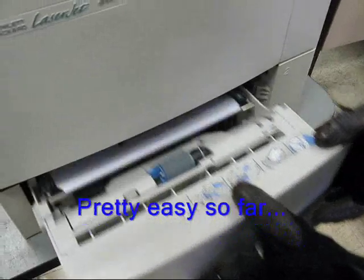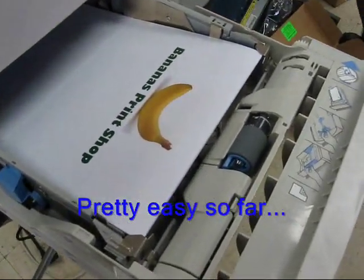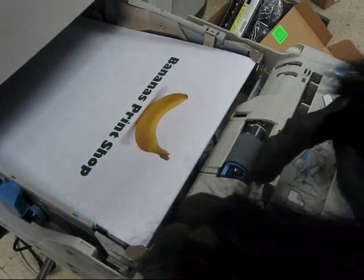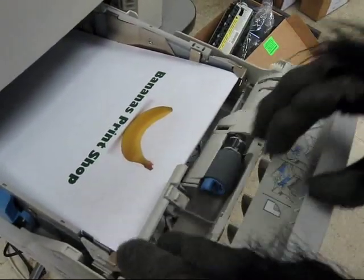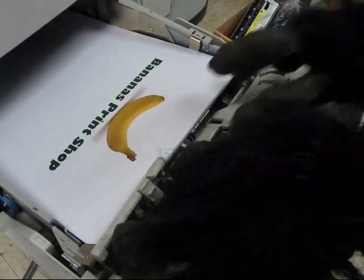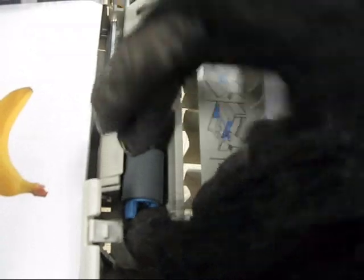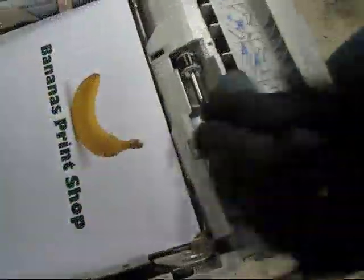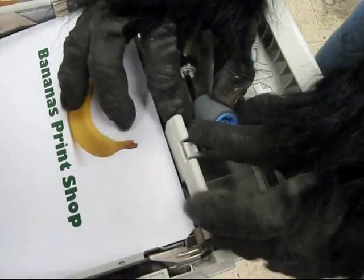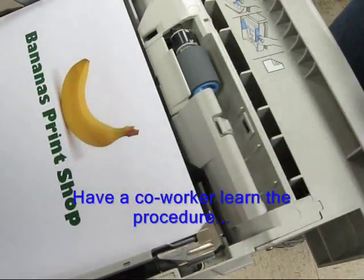Open your paper drawer. Locate the little door on the left side of the paper drawer and flip that open. Once that door is open, you can press the tab on the roller and it will slide off the shaft. Take your new roller, slide it back on the shaft and it will click once it is on all the way. Then close your door.